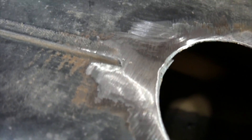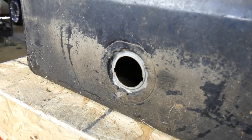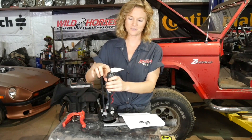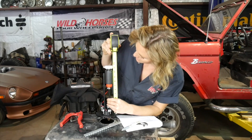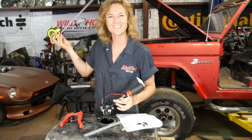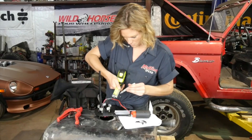Okay, that's all we need — now that's gonna hold a gasket. Those two lines I thought were pickup and return are actually vents as well. The pickup went right there, which we'll reinstall, and then cap those off. I returned from Dallas just in time to decipher instructions. All we know is we want this pump one inch off the bottom of the tank. Our tank is 10 inches deep, so we're gonna set it at nine inches to keep the pump off any sediment or water. This measures out to 11 inches right now, so we'll cut it at nine.